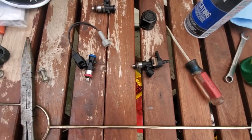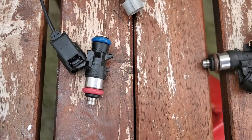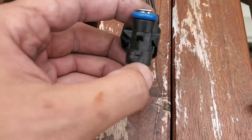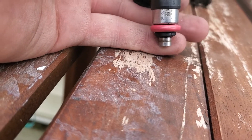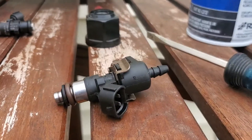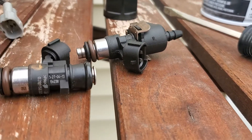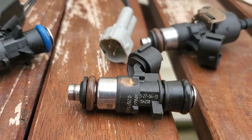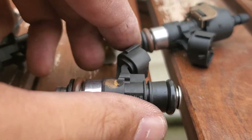We're going to talk about these injectors today. This is the Gray Area KTM injector, which is essentially just a Bosch injector. If you really wanted to, you could probably just look at the part number and buy it offline instead of directly from them. This essentially would be the KTM version — it's also a Bosch injector. I think these are EV14 style injectors.